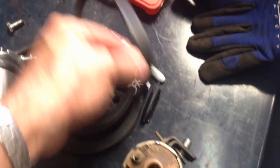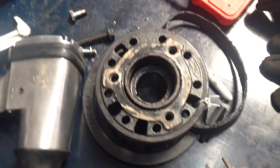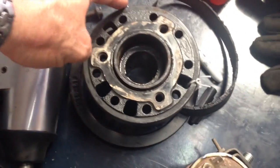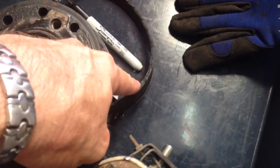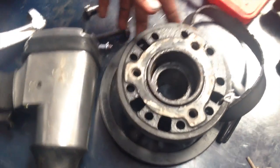The good thing is that we took it off before it came apart. They will come apart, guys, and serious damage will ensue on your harmonic balancer. You saw the video before with the crusty rubber — there's the edge of the crusty rubber, all the rubber out of it. That's a unique look at a harmonic balancer. Your one-piece balancer is now a three-piece balancer.